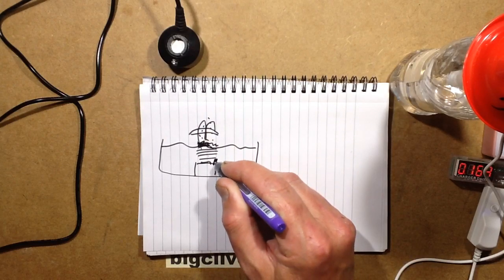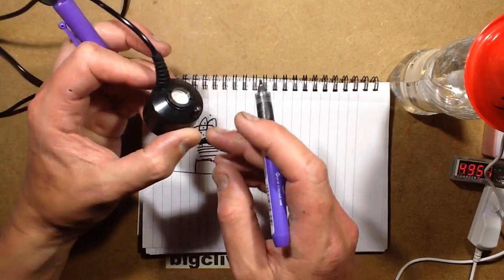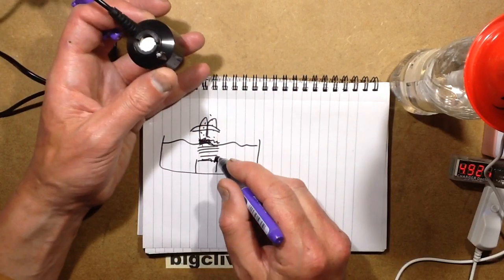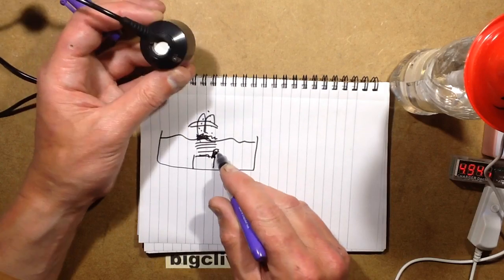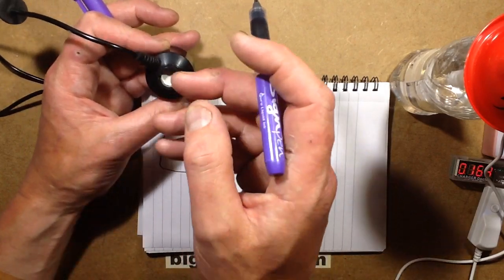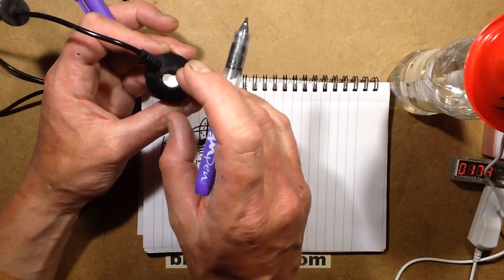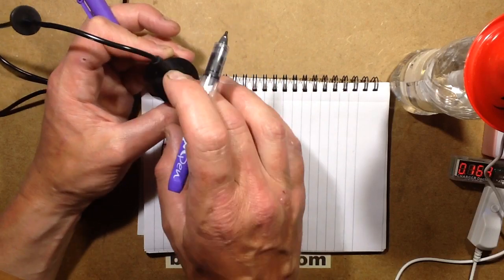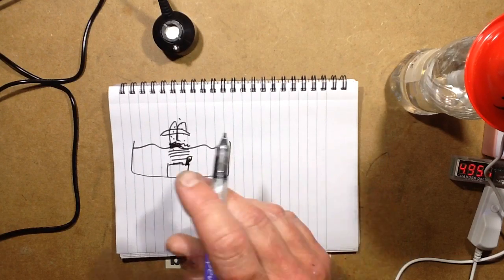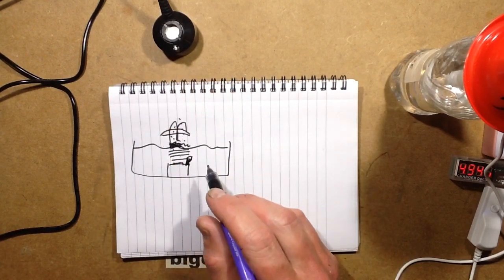There's also a little sensor — in this case a little metal stud. Other ones just have maybe an inductive sensor, and they're purely to detect that the water is above the level of the disc. Because if the water level goes down too low and the disc is dry, then the disc will overheat, and that's the point at which it can suffer damage.